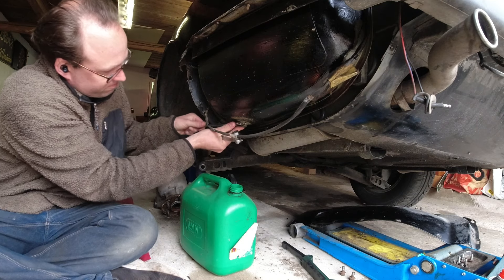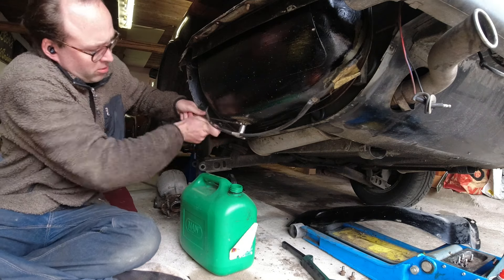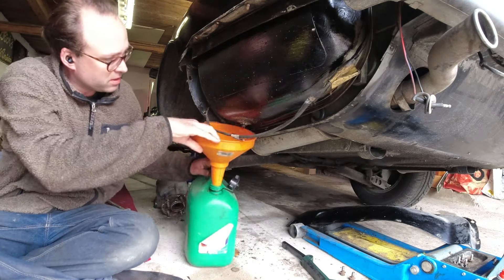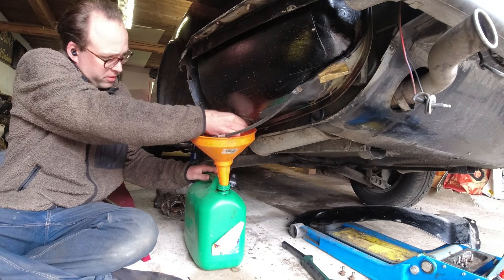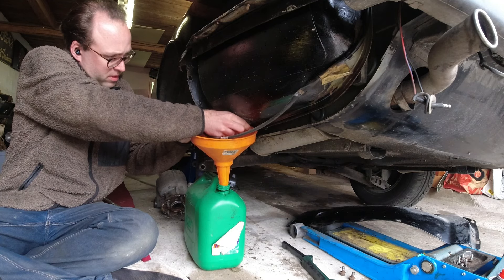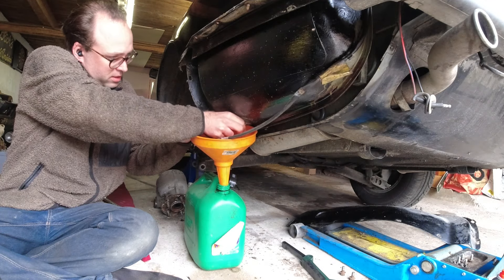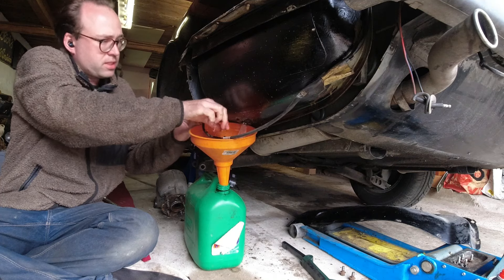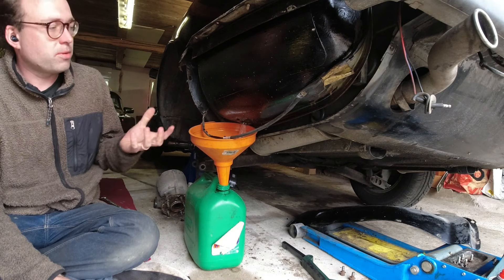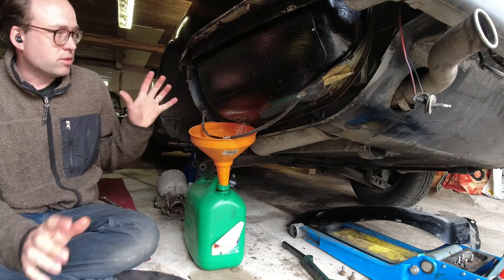It's a tight fit but I'll crack this one loose — you don't want the big one to come loose first because you'll have a mess when you try to drain it. Try to just get the small one first. Then you can pretty easily drain these tanks — that's the nice thing about these cars. You can drain them without taking the covers off, though sometimes the big one is tight and you can't get it out with the cover on.